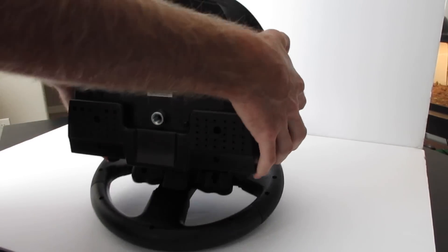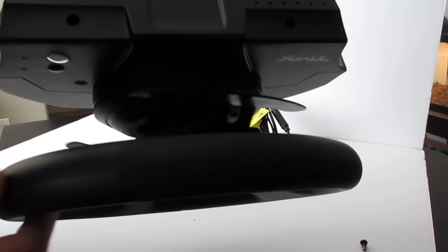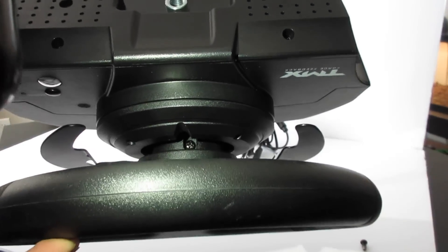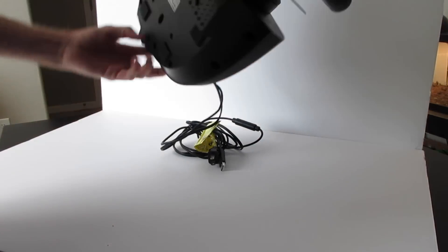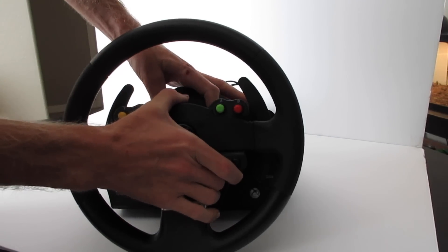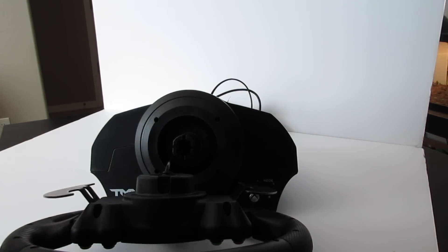The screw will fall into the base if you have it leaning back too far, so the best thing is to lay it on the wheel and flip it forward. Keep all your screws separated. Turn the wheel and you'll see the groove with the other screw. There's one on each side of the steering wheel. Once those are removed, the steering wheel will pull off — it'll have some resistance, so wiggle it gently as you pull.